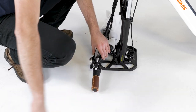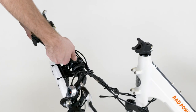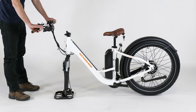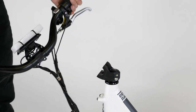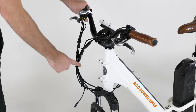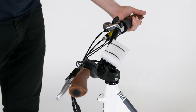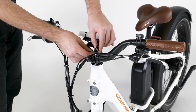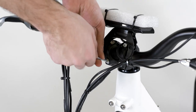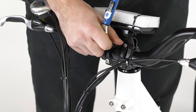Remove the packaging from the sides of the handlebar and snip the zip tie securing the stem faceplate to the handlebar — it's held in place by the display. Orient the handlebar so the brake levers face forward and the three button remote is on the rider's left side. Trace the brake cable from the left brake lever to the brake caliper and make sure the bundle of cables is not twisted. Place the handlebar on the stem so that it is properly oriented and centered. Thread the four bolts by hand and then use a 5 millimeter Allen wrench to tighten them evenly in an X pattern. Ensure the gap between the faceplate and the stem is evenly spaced, then torque the bolts evenly to 10 newton meters.